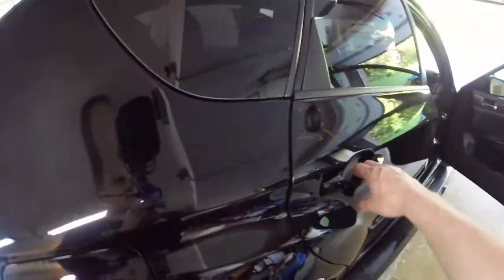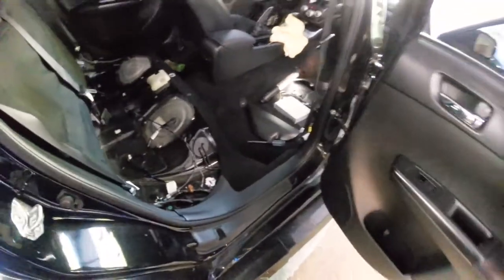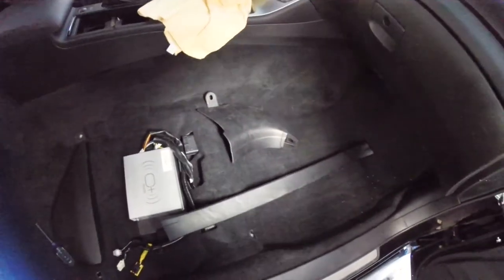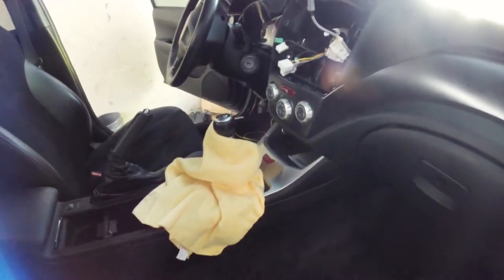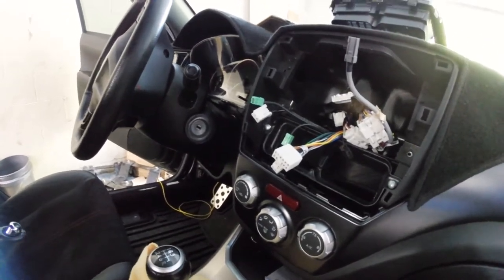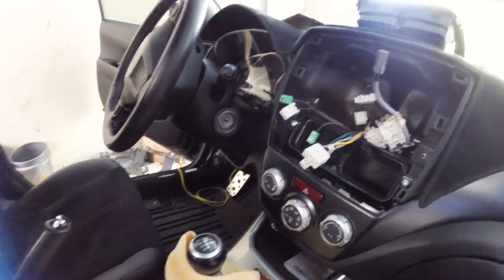I've started reassembly a little bit because you're supposed to reassemble as you go. You wire-tie it strategically as you go. I've got all of this installed up to here — obviously the back seat's not in yet. There's the amp up there. The seat is actually ready to go back in. The wiring is run up along here and sticking out right there. I pulled all the factory subwoofer wiring out because it was in-line — it would have been double in-line, and I figured why not get rid of it. They ran it up along the driver's side footwell and up under the dash.